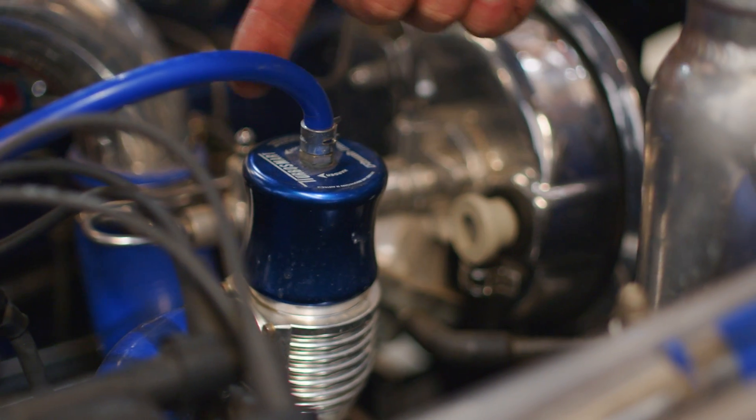While we're on the topic of boost leaks, make sure the blow-off valve has a manifold pressure reference back to the inlet manifold. Without this, the blow-off valve will be overcome when boost pressure exceeds its spring pressure, and you'll be chasing a boost leak that only appears once the engine's under boost pressure and load. Boost can also leak from the intake manifold gasket or the throttle body gasket, so make sure they're nice and tight. If you're unsure, the tuner might have a smoke tester — a tool that feeds smoke into the intake system at low pressure, and any leaks are quickly discovered. Even the smallest leak can rob horsepower and performance, which is why we visit a dyno.